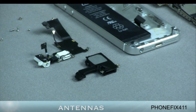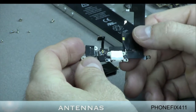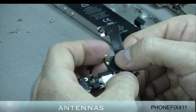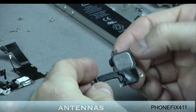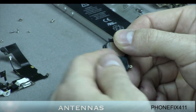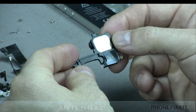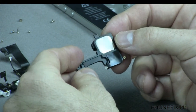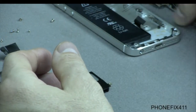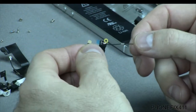On the antenna video, the iPhone 5 actually has a couple of service antennas. This we consider antenna A, and here's the feed line plug for it right here. And this, on the ringer loudspeaker, this we consider antenna B. We also have your WiFi antenna right here, and that's at the top of the phone. We'll get to this one in just a second.